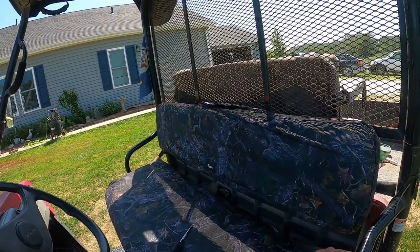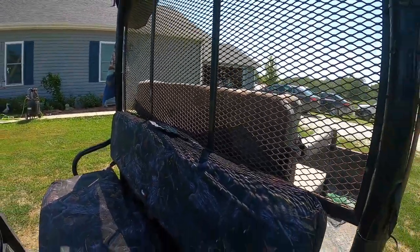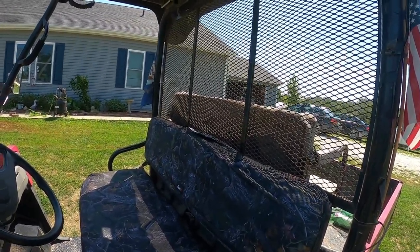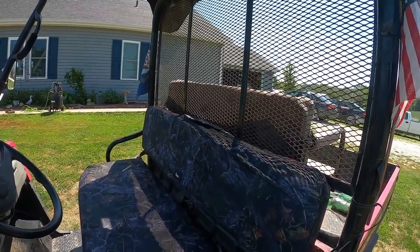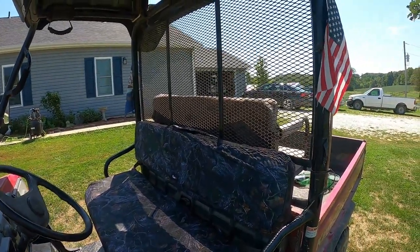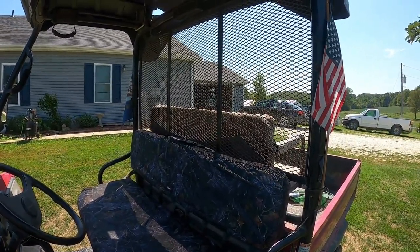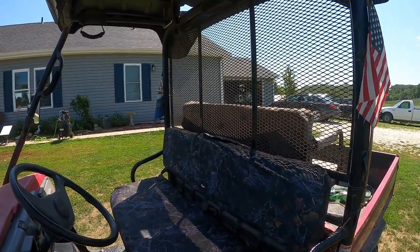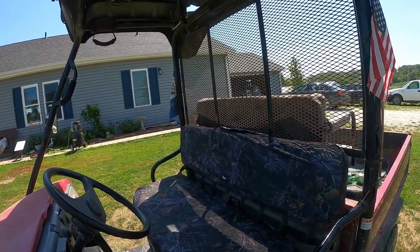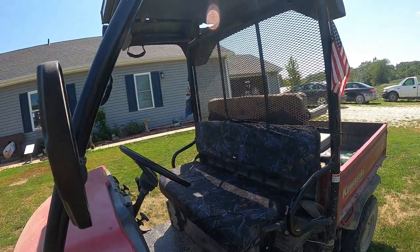You can see there's still some shaping I'm going to have to do — there's a little bit of wrinkles here that are probably just going to come with time having it on. A little trick I use — I use this with Jeep tops all the time: it's about 110 heat index out here, it's sunny and super hot. When working with Jeep tops, especially on cooler days, I'll set them on the hood in the sun and they become a little more elastic or stretchable. I did that with the top part of this seat and it worked better for getting it on and stretching it. If it's cooler when you're putting one on, set it on your car or truck where the engine is warm, let it heat the material up a little bit, and it makes it easier to handle.